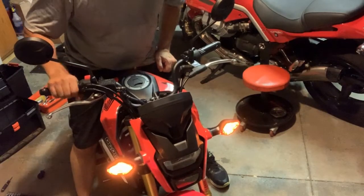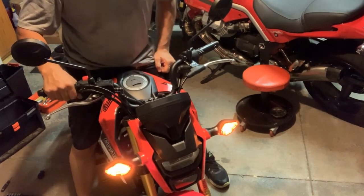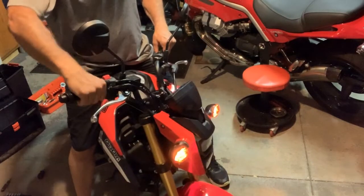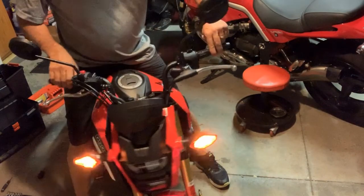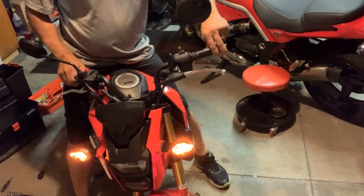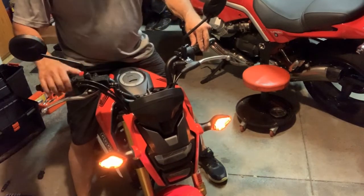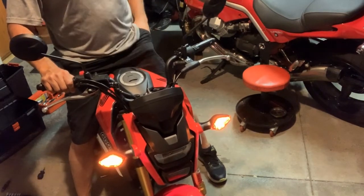And now you can see after tightening it up, there's no play in the throttle at all. It's right there. Now I hear that throttle closing. So I know that I got nice springiness. Now if I turn it full lock this way, the cables are nice and straight. Most motorcycles you go sort of on the inside, you might have to muscle a little bit, but watch what happens. Once you straighten out, it snaps right back, okay? Now let's see what happens with the throttle when I turn the bars, just to make sure that we don't have any binding.